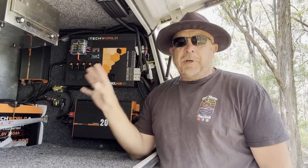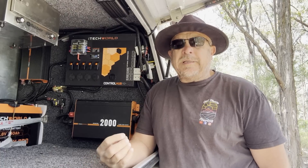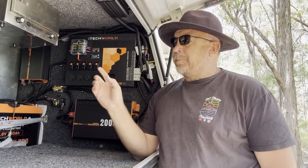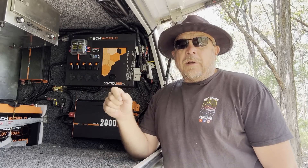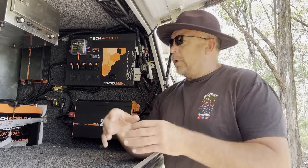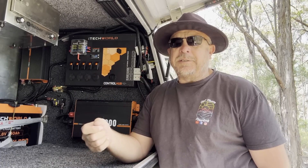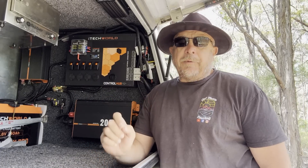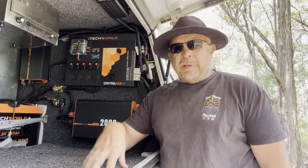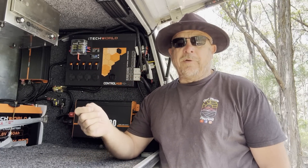You've probably seen the video where I did the complete install. Now probably about six or seven weeks after that I found that I had no power to the fridge. I rang iTechWorld, a number of emails between me and them, and I had to recalibrate the indicator to the smart shunt and recharge the battery completely. I recharged it overnight, got it up to 100%, but over the next day or two the percentage dropped even though I was parked in full sunlight or had been driving for an hour or two.